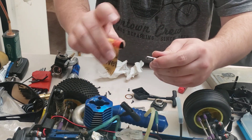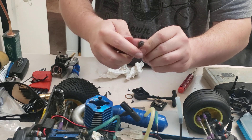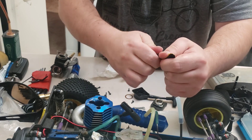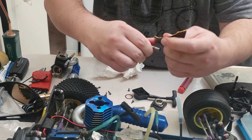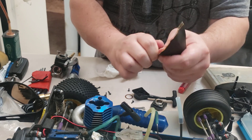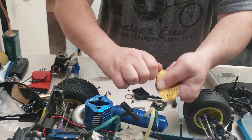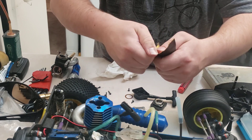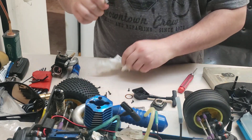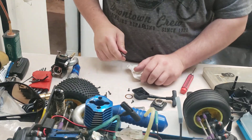Like I said it slips, so take a little bit - this is 800 grit 3M - and just right where the one-way bearing sits, just rough the surface. You're not trying to remove material, you're just trying to rough the surface and break that bit of a glaze on there. People say oh if you sand it you're going to reduce the size - well, you're not trying to reduce the size, you're just trying to break that little bit of glaze, like when you hone the cylinder in an engine when you're going to put new rings in it. That's all you're doing, essentially honing the surface. Just give that a couple of twists, go back in the opposite direction. Like new! See that's all we're aiming for - just to take that glaze off, not remove material.